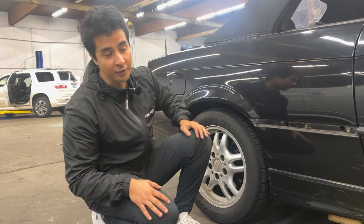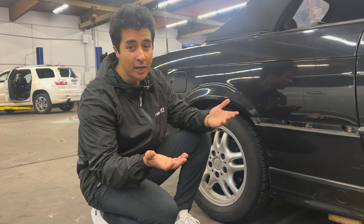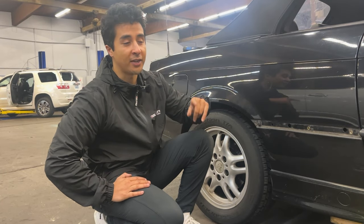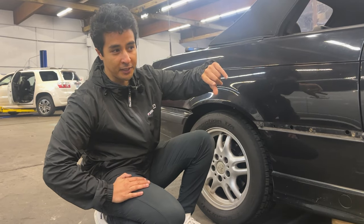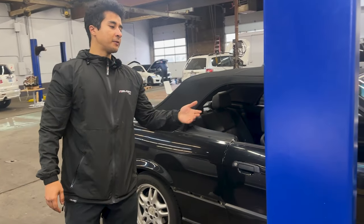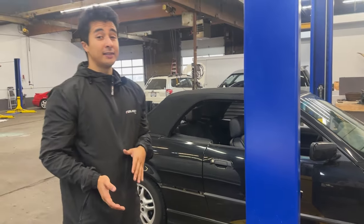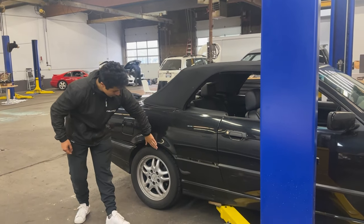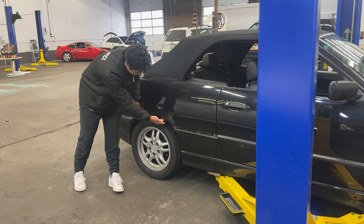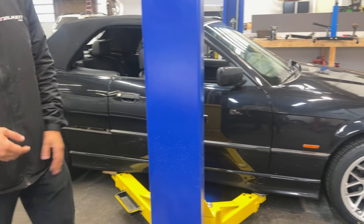Also with rolling the fenders in the front just very slightly, and maybe even removing the fender liners, might have to be something that we do. But what's nice with these ECS Tuning coilovers is the fact that we can actually use the dampening adjustment to tighten that up a lot in the front. So now we'll get this up in the air, take the wheel and tire off, and start masking things off so that nothing gets compromised on the actual paintwork itself on the outside, while we focus on what's happening behind the scenes so we can run the big thick boys.